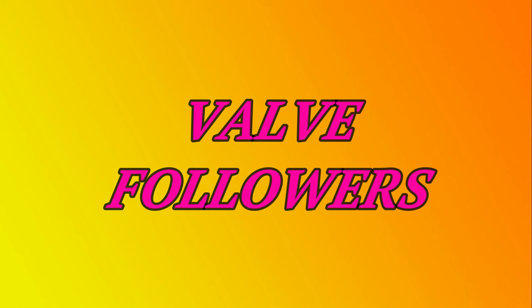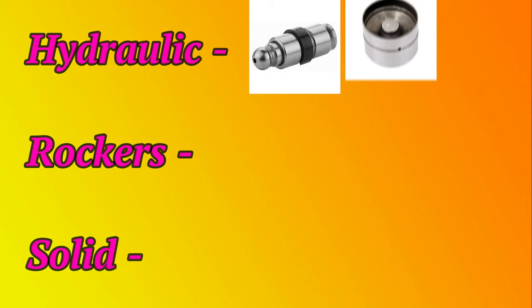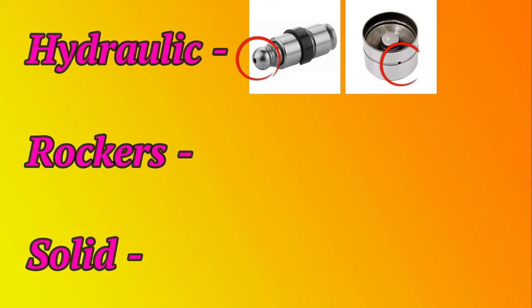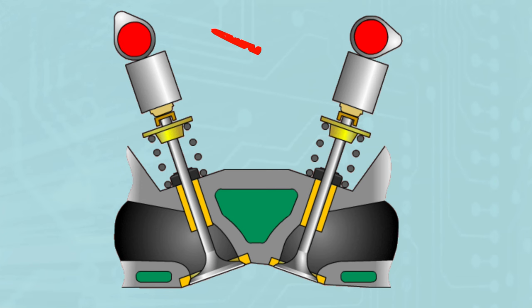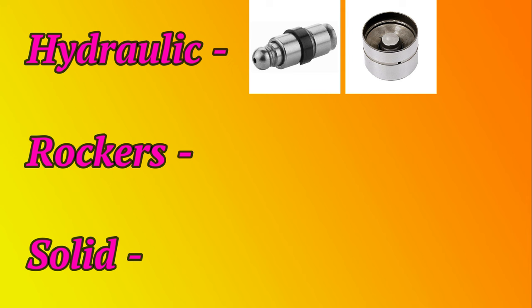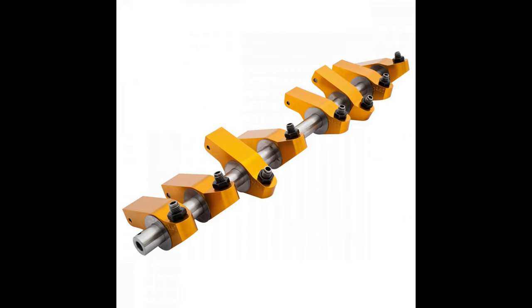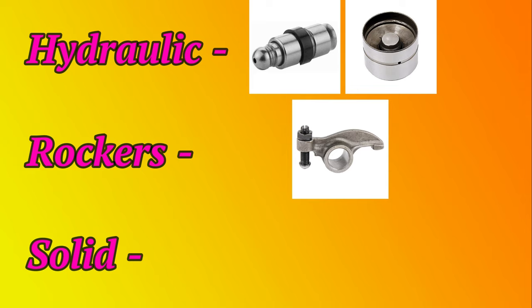In all of these engine designs we have a valve follower — the component that transfers motion from the camshaft to the valve stem. Starting with the hydraulic valve follower or valve lifter: these come in cylindrical or bucket type shapes, and you can tell they're hydraulic as they have a small hole for the oil passage. The cylindrical type are typically used with a roller rocker, whereas the bucket type are more direct right above the valve. They're operated by oil pressure from the engine. The advantage is zero maintenance as long as routine oil and filter changes are completed, but the disadvantage is that due to hydraulic principles it won't rev as high as a solid lifter. The rocker lifter is typically used in older pushrod or single overhead cam engines. The advantage is they are easily adjustable and you can replace them to increase the ratio for more valve lift. The main disadvantage is they're less direct and give a lower RPM limit.